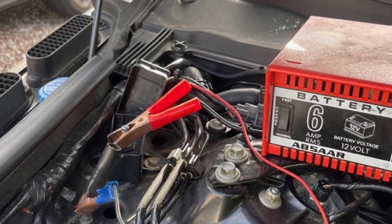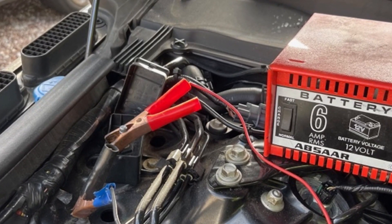To cut a long story short, you may just need to charge your main battery with a good charger, or drive for several hours without turning the engine off to let the system charge the TCU module battery.